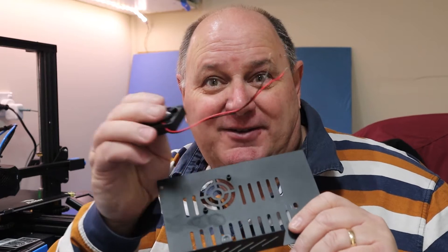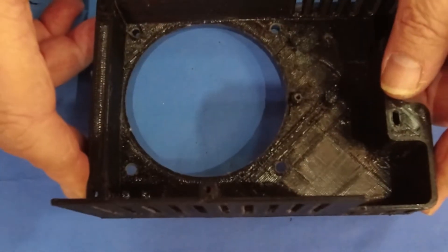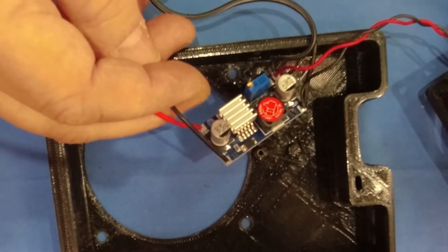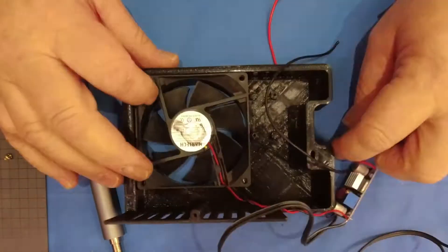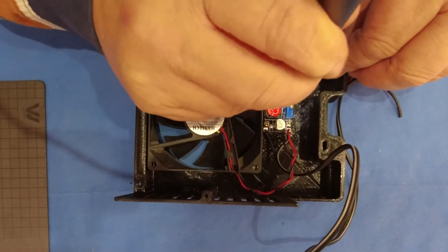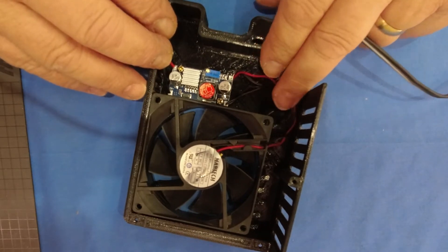While I'm changing the mainboard, I'm also going to change the cover and fan. The original cover only has a 40mm fan, so I've put an 80mm fan in there for much improved airflow — replacing the original cover with a 3D printed one that allows me to fit the 80mm fan. This is a 12 volt fan, so I'm going to install a buck converter. There'll be links in the description for the cover file and for buck converters. These additional wires I've got running here I'm going to run up to some LEDs I want to place on the printer so I can see better on camera.